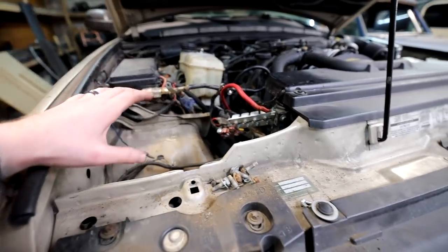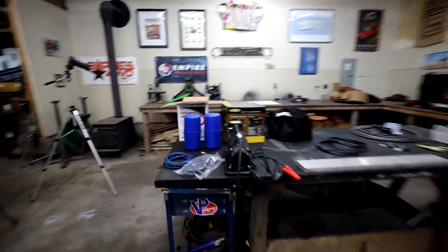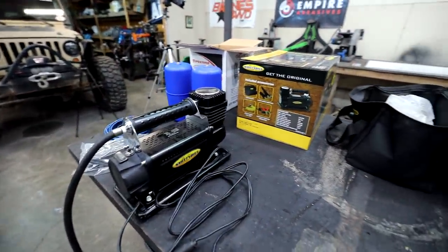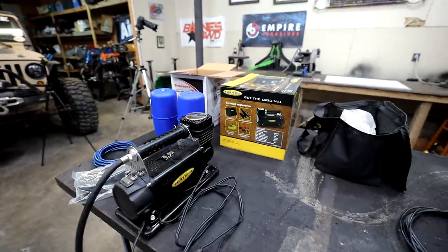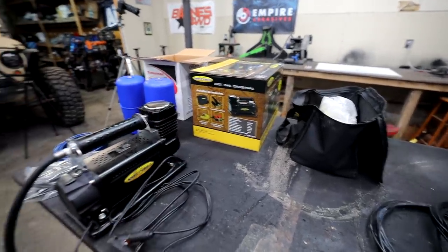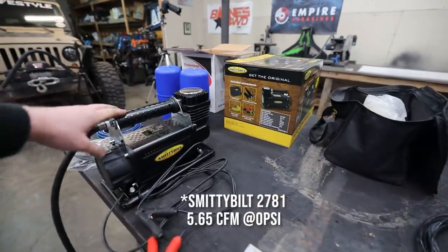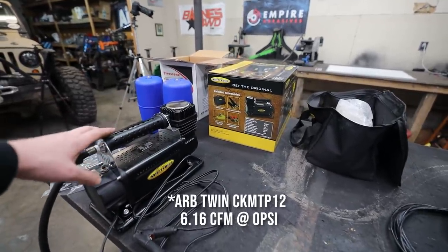I just freed up a bunch of space under the hood. We're going to relocate the battery up a little bit and fit a compressor here, then relocate our air box and fit a compressor there. The hardware we're using is the Smittybilt — I'll link this compressor in the description. I got these from 4WheelParts. These are a bargain, and I got these instead of the ARB Twin because I wanted to build a system affordable to anyone watching. The CFM rating is 5.6, which is bananas — almost as fast as an ARB Twin. We're using two of these, making it almost twice as fast as an ARB Twin, so it's going to fill those 37s super fast.